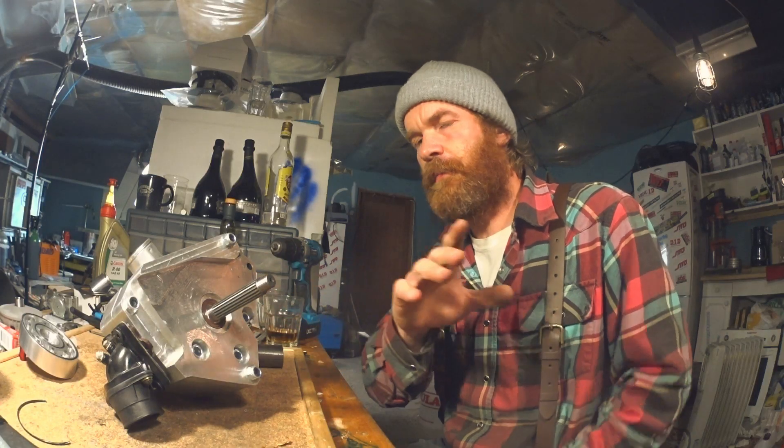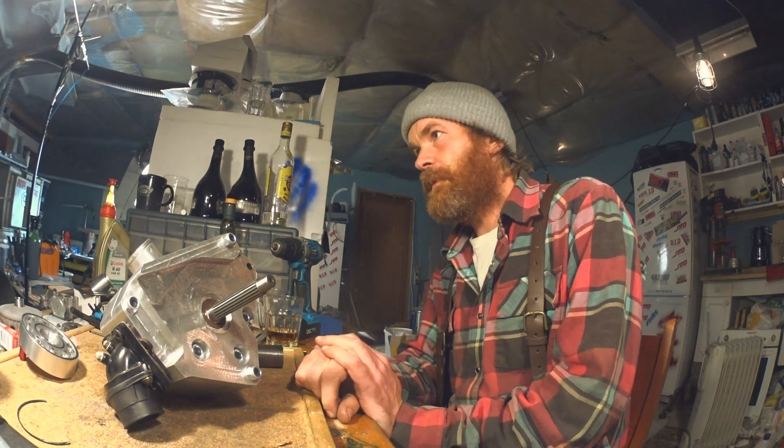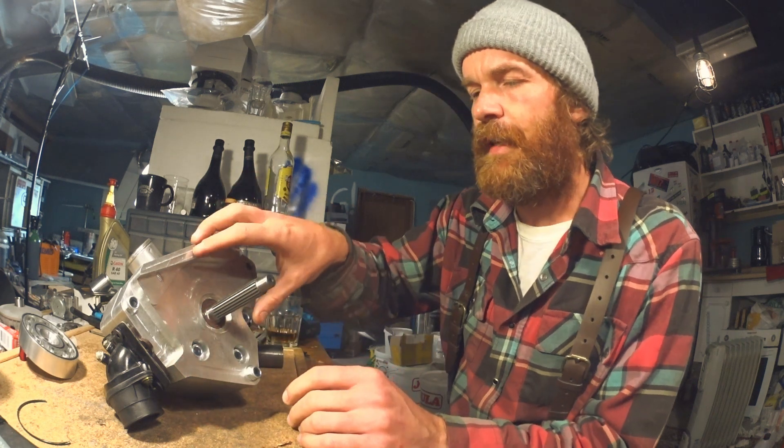It's been an hour and I have to leave it in there a little bit more. I need the plating to be completely stripped for the new plating to bite. I don't want to leave it for too long, because then the aluminium will start suffering. There's really nothing to do but wait — see if the plaster removal process works and wait for the plating to strip. I thought I'd do a little rundown of the case.